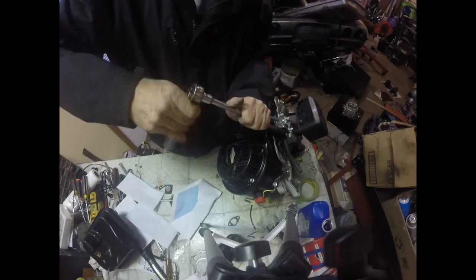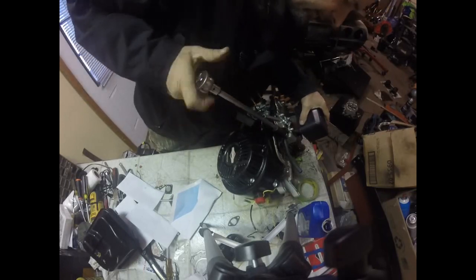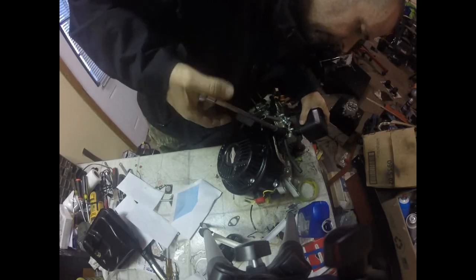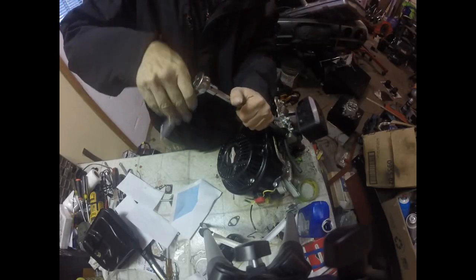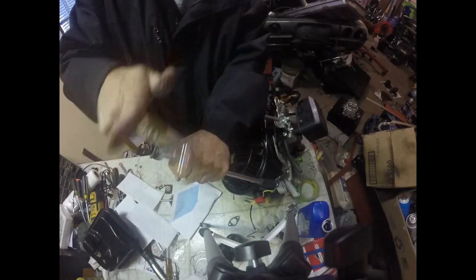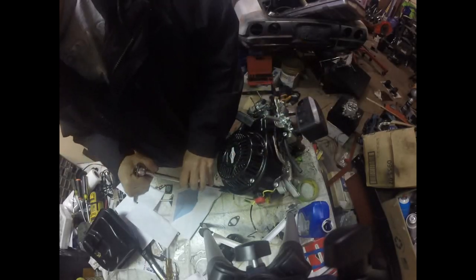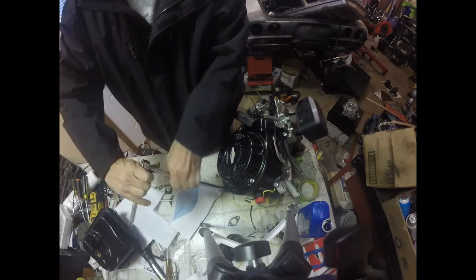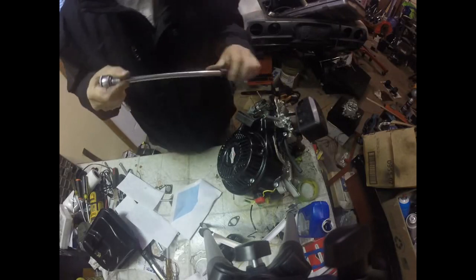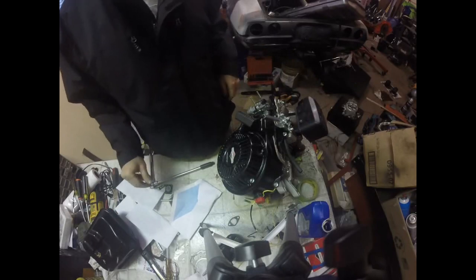I tighten these 4 bolts up on the starter cover. Hopefully I don't strip them out. Well, I think that one's stripped out. Might have to do another thread repair. Alright, I have to take it back apart and do another thread repair. But just for today, I'm going to snug them up for you, and then we'll do another thread repair. That's what happens when people over tighten them. So I guess I didn't notice it, but that one was over tightened and stripped out. Alright guys, see you next video.